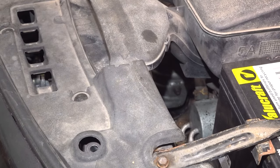Now take your negative battery terminal and connect it to the battery — sometimes it can make a little spark. I cleaned up all the corrosion and got rid of that pad that was down there. Sometimes it's useful, but if it was full of corrosion like mine was, it's actually worse off being there, so you're better off taking it off. Put this battery terminal back on and make it nice and snug. Don't crush it down because it'll actually stretch it and you'll have a hard time tightening it in the future — as long as you can't spin it by hand, you're good to go. Keep in mind that on some of these vehicles, when you disconnect the battery, you may have to recalibrate the steering angle sensor. That entails turning the steering wheel all the way to the left and then all the way to the right, then centering it up so the sensor can relearn its positions on both ends and in the center.